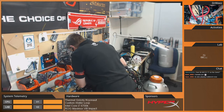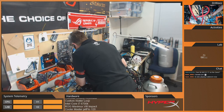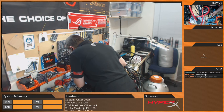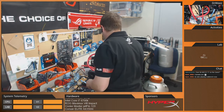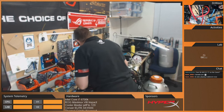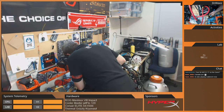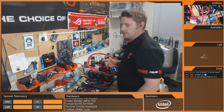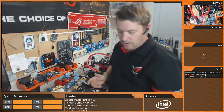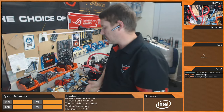Here again, I think as overclockers, we are our own worst enemies. Because we're running these slimmed down versions of operating systems, it's just become a bit of a pain in the rear end. With the driver CD that ASUS supplies, that hotfix is in the driver folder. Once you've applied the hotfix, then you can install the video card drivers and everything magically starts working.